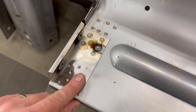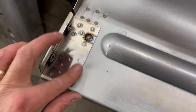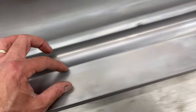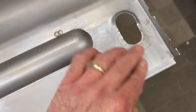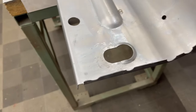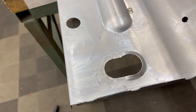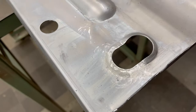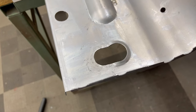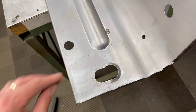Our welding is done. I've ground down this one knob of weld - this one can stay there. We are going to put our hidden subframe tube right in here - it's going to run all the way down to here. Down here, you need to flatten out this little feature. I believe this is a fill hole for the factory dipping-in-primer process to get primer down into this area. But anyway, it doesn't do anything now - there's no wires going through it. This is going to get partially covered up with that piece of tubing, so you need to flatten that out. You don't need to do the whole thing, just up to the bottom of this stiffening rib, which also acts as a place where the wiring harness runs.